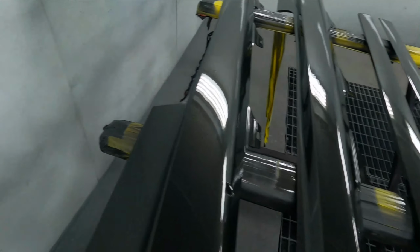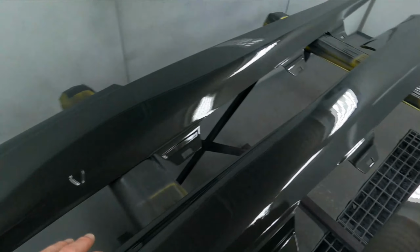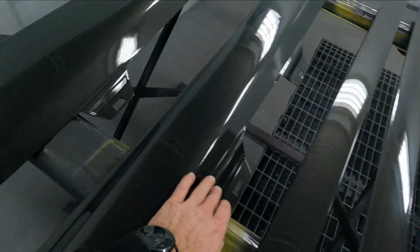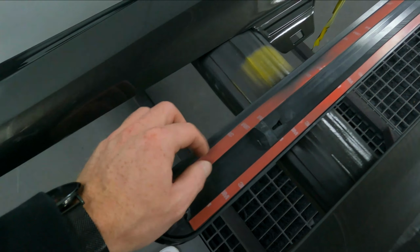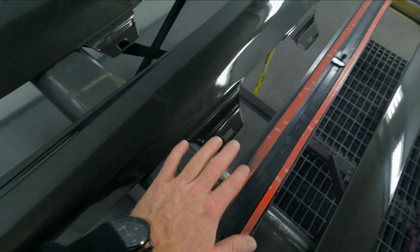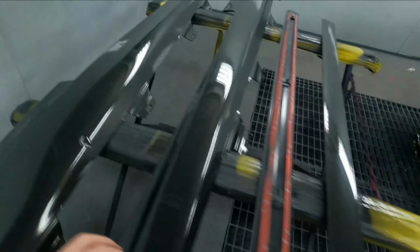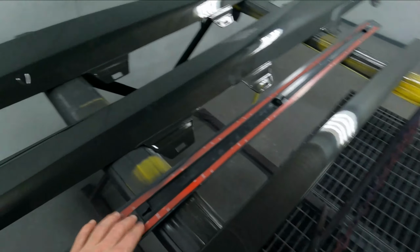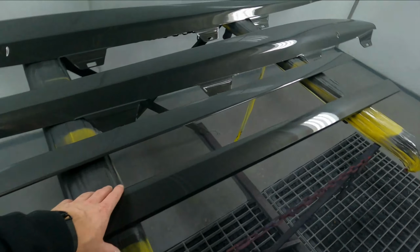So these panels will go on. I don't know how these clips work, but I'll soon find out. I need to get these off, because look, they give you this double-sided tape, which is all right for these, I think. But they put them on here, and guarantee you can't just leave that on. So yeah, discard that, guys. You're going to need some sealant to hold that in, some Tiger Seal or something. I've got this.